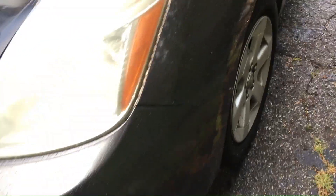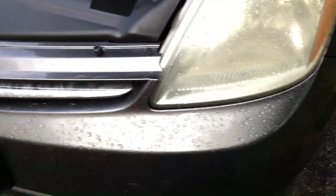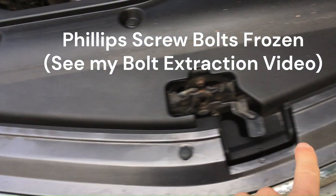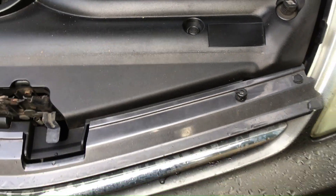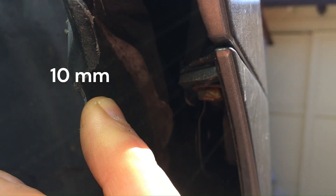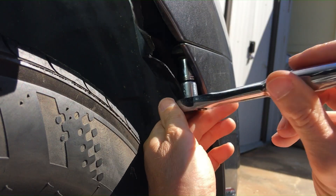When it is working, you'll see turbulence like this — this is how it's going to look at the end. To get access to that pump, first you want to take off the bumper. It sounds kind of hard, but it's not really. There's a screw where I was just pointing, then there's some push pins and retainer clips. Those were supposed to be easy but they weren't — check out my video with the link. Once you get those off, you pull off the top of the bumper. Here's the other 10 millimeter screw on the side. Just peel back the plastic fender panel and there it is — any old 10 millimeter screw that you take off.